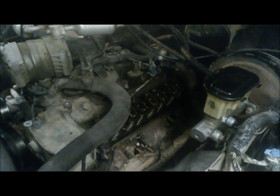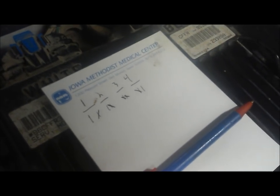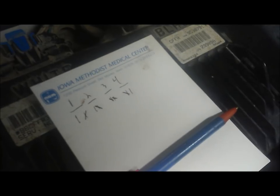We're working on Eric's truck today. There was a valve issue — the heads were replaced by his shop and they didn't make the valve adjustment properly. There's some pretty good clatter coming from the valves. Quite a few of them are loose where they should be set to their proper preload, and there's rocker arm movement, which is not what you want. We're going back through to get this set up right. The first thing we like to do is write out which cylinders and which valves you've done.